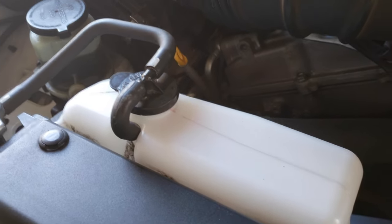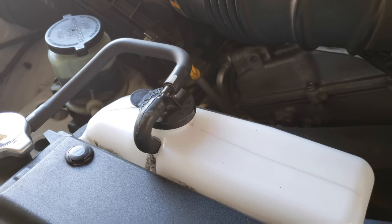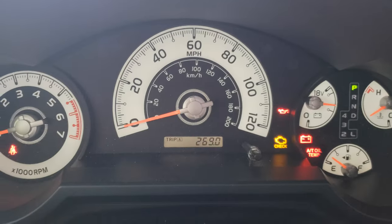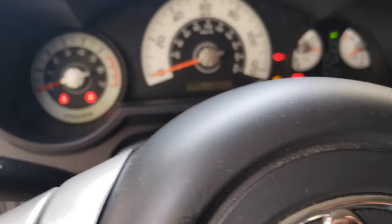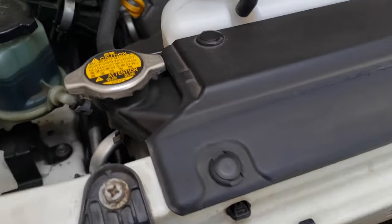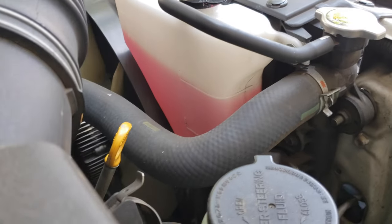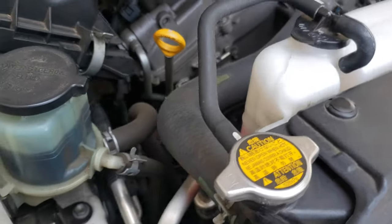I'll check back again next week — we're going to be doing a long drive of over 100 miles. We have just completed that drive home; the round trip mileage on a single tank of gas was 269 miles, literally almost two hours of driving. Coolant level should be at its peak right now. So far everything looks good — no overspill, no crust, coolant level looks pretty good, and everything looks normal. That is very encouraging.